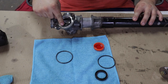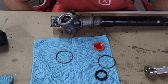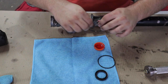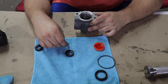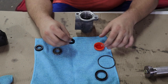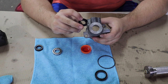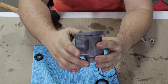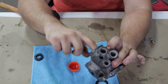I don't have a lot of confidence with how I installed this seal — it was very difficult to install even with using this seal driver tool, it just doesn't look right. We'll see if it leaks when it goes back together. We can now get our old bearing and new seal back into this housing. According to the factory service manual this bearing does not get greased, and it's feeling better now that I let it soak in lubricant and moved it around. The seal orientation is flat side with numbers at the top, spring side facing down into the housing. I did get the bearing back in using my little press — the bearing moves again.